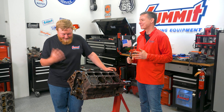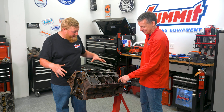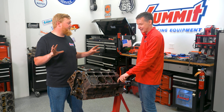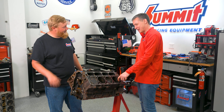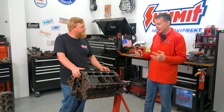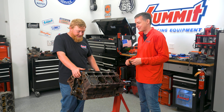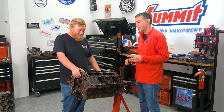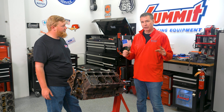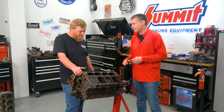It's out of here! We got this thing all torn down and it went really fast. Now just looking inside this thing while tearing it apart — it is absolutely gorgeous. It's a confirmed low-mile six-liter and looking on the inside this thing was taken well care of. No ridge on the cylinders, the pistons aren't super carboned up, the valley is nice and clean — so it doesn't have the muck you see when people never did oil changes. The lifters came out nice with no weirdness, nothing came flying out. So I think we got a good one. With a good one that means we can shove a bunch of good parts in it. What we're going to do first though is check the camshaft bearing clearance — they look good but I want to know how much clearance we have so that if we see lower oil pressure later, we know what's going on.